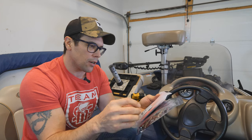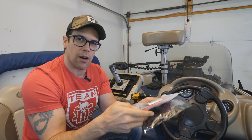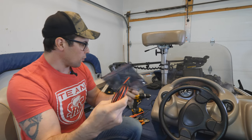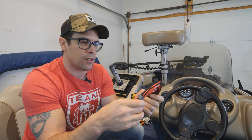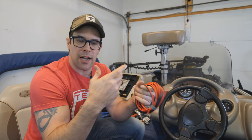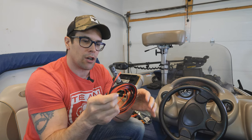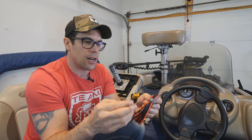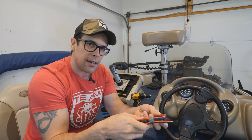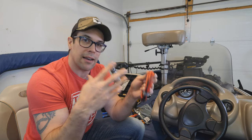Now another hot topic — the wiring. I actually bought some 12-gauge wiring here, but we're not going to use the 12 gauge today — that's for another video where I run new wiring to the dash for some accessories. Over here I've got some 14 gauge, and this is very important: all these wires have the same attribute, which is tinned copper. Regular copper connectors are that coppery gold color, whereas tinned is actually silver. They put a coating of tin on top of the copper, which creates a layer of anti-oxidization — that's why you'll see tinned copper lugs and connectors for marine use.